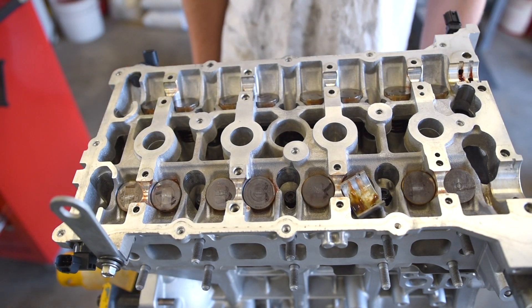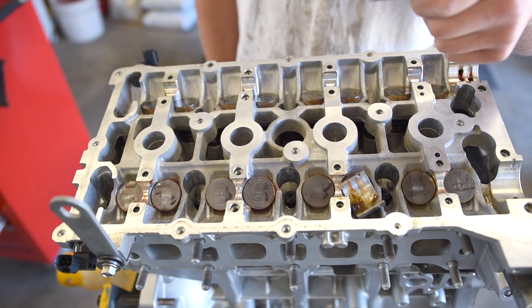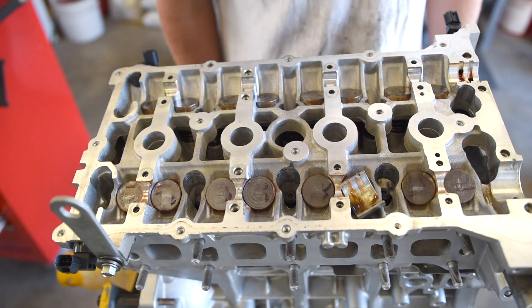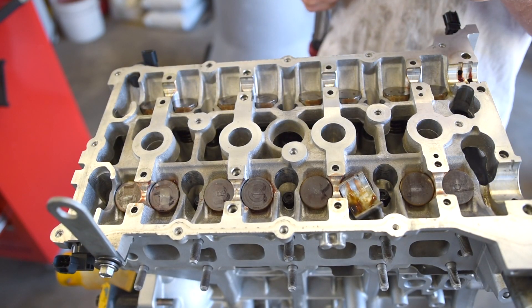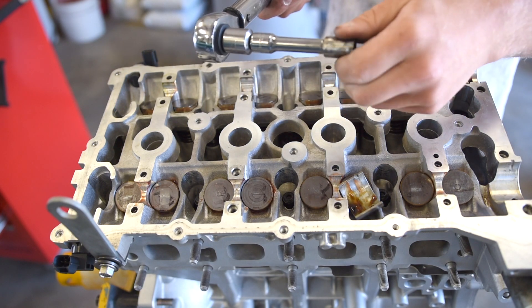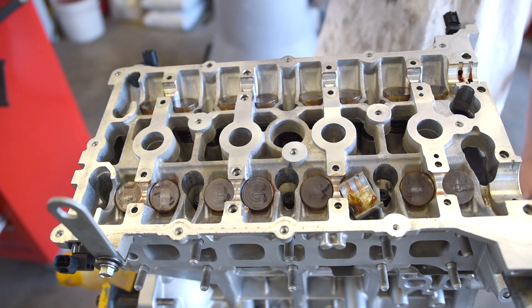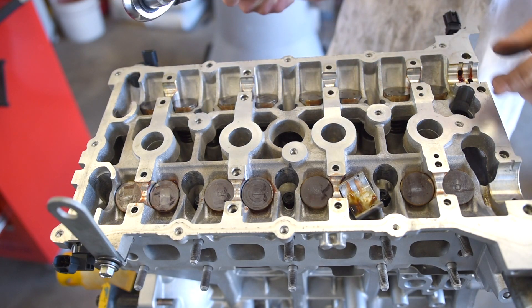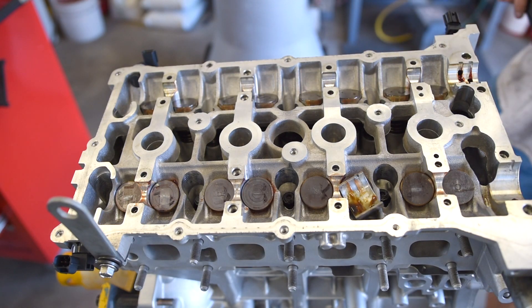There's no way a quarter-inch drive is going to hold up to 90 foot-pounds, so I'm actually going to try to grind the socket down to get it to fit down this hole. To get to the two front nuts with the half-inch socket, you have to grind it down. A regular socket will not fit down the hole, and a quarter-inch is not strong enough. Take that three-eighths half-inch socket, grind it down, and it'll fit. Also, all of these have to be 12-point sockets.